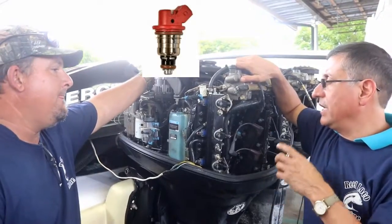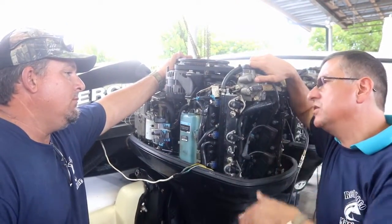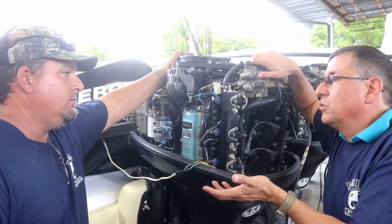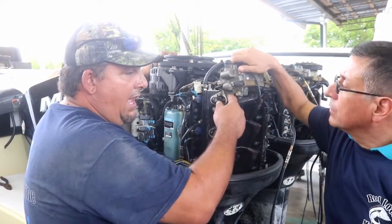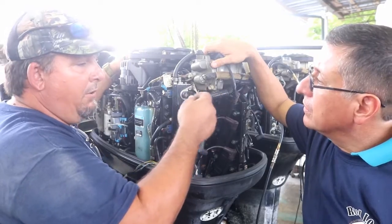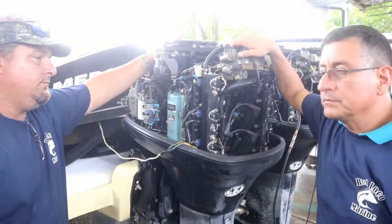Can I check the injectors exactly the same as in a diesel engine, with the engine running? Can I check if the voltage enters? Yes, you can. You prepare your multimeter. Correct. Perfect. Okay. And you can also do a drop-down test if you want to isolate the cylinder. Let's say you have good compression and good spark, and you think it's a bad injector, you can unplug each one and see if the cylinder changes or not. Okay. All right. Thank you.